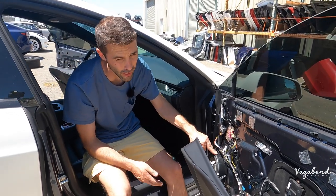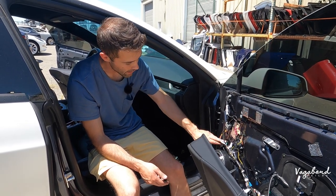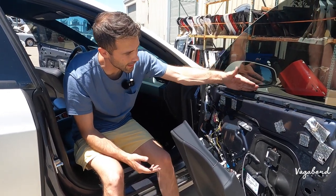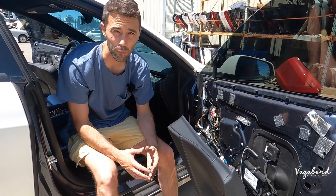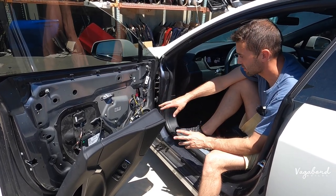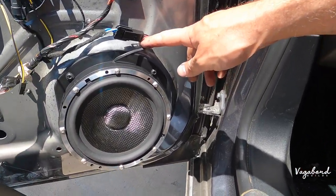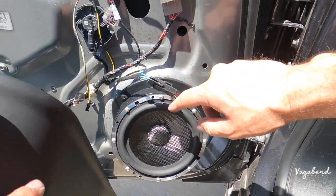What we're going to do is place that door panel back on the same way we took it off. You're going to tuck it in here, clip it, clip all your clippings, and then put in those screws and we're pretty much done. We did the second driver door speaker and that is completely done — this is how it looks. Very nice, snug, plugged-and-play, premium sound. Make sure your plugs are all in when you're putting your door panels on.